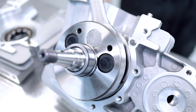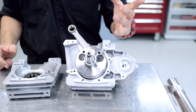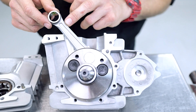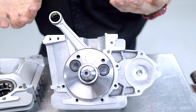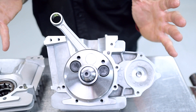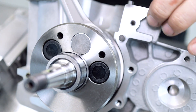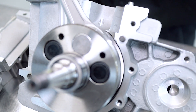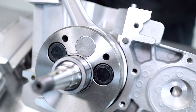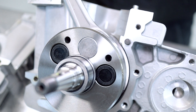The sleeve is interchangeable too, so if you do get wear on it, you can take them off and refit brand new ones. The billet conrod has been installed here on the crankcase and that comes supplied and fitted. You can buy this package as an upgrade for your current engine — it's about a thousand bucks here in Australia. You can see the big 20mm crank pin in the crank axle — that bad boy is never going to snap. That was a bit of an Achilles heel. What I like about this company is they identify problems and just iron them all out until you have problem-free racing.